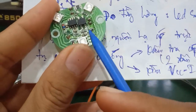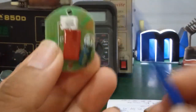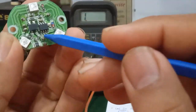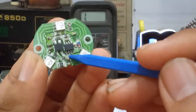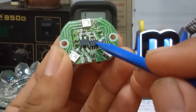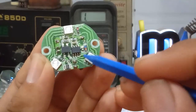You check the voltage after the rectifier, or at the filter capacitor (electrolytic). The filter capacitor smooths the rectified output. After rectification and voltage dropping, the DC voltage should be around 12V DC, which supplies power to the IC LED driver RGB controller chip.